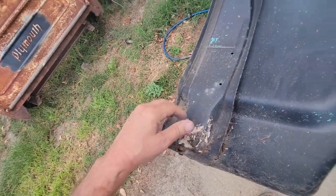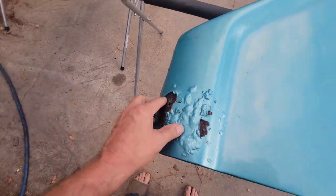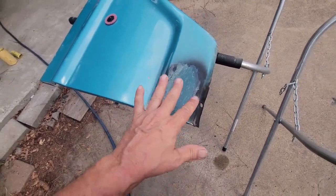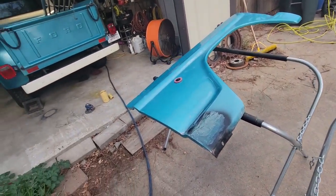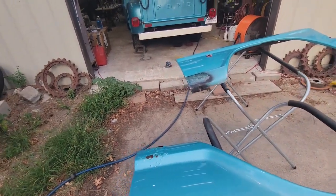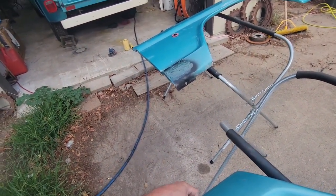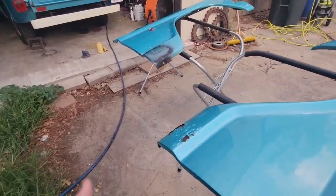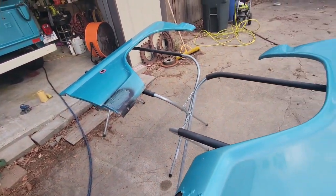Looks like someone had already started repairing it — there's some bondo on the inside. The big yuck spot on the outside is on the driver's side. The passenger side I cleaned up, but it's still ugly with some holes all the way through. I'll put some fiberglass on it, smooth it out, throw some primer on it — good enough until I get around to replacing the fenders. I'm not slapping bondo on it to sell it, I'm just getting the ugly off and going to drive it around. It's a daily driver, not a for-sale truck.